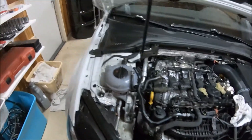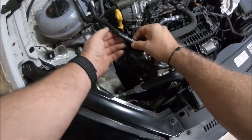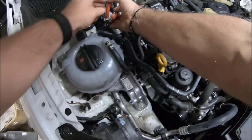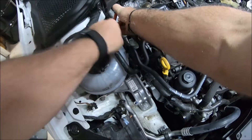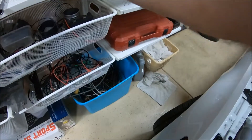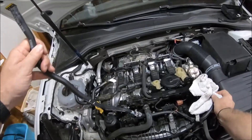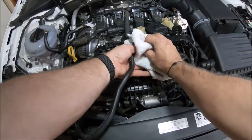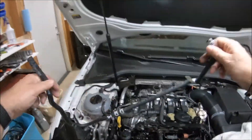For this one here, this is why we have the tweaker screwdriver — go ahead, push down, and then you can separate it. That line comes out. Disconnect here. And then again with our edge cutters, we've got the same style of little spring clip. Push it together and pull it off. Unclip here, get as much fuel as we can out of here, and then set that aside.